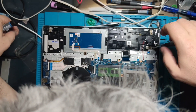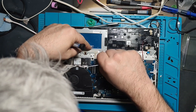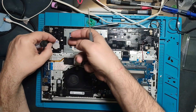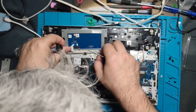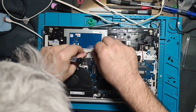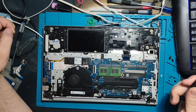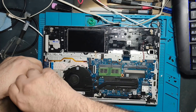I'm now removing the trackpad, which is quite large. When taking it out, be very careful — some people might think there is nothing underneath, but actually after removing the trackpad, the display is exposed underneath. Be extra careful not to damage the screen while working on the laptop, because in the trackpad area the screen will be exposed.